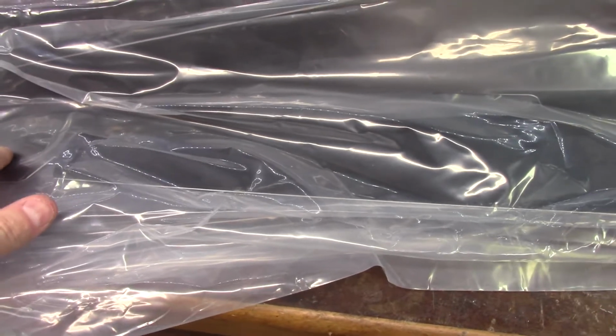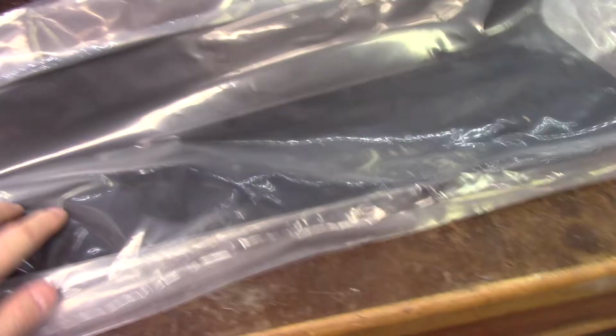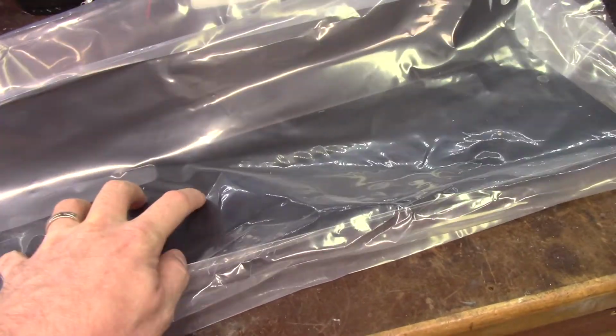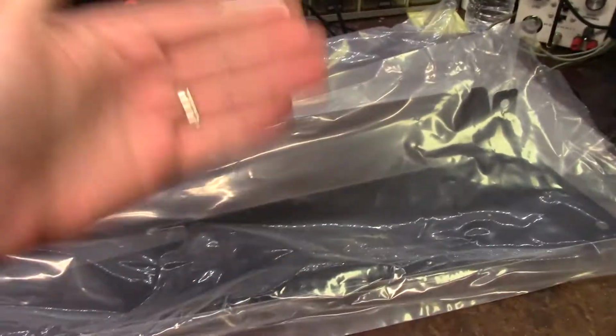And one of the things I never liked about these trucks is that the air can come back around the hood to the radiator, so that heat recirculates. This will make it so when it's drawing air through the front, it pretty much solely draws it through the grill. It's kind of a defect in these things. There isn't really a dam there to prevent that from happening. So I figured I'd give these a shot.